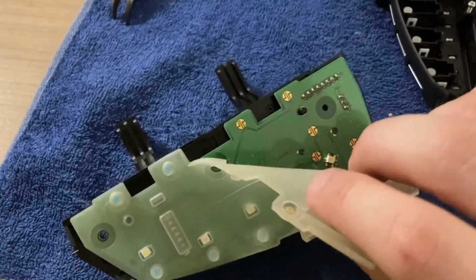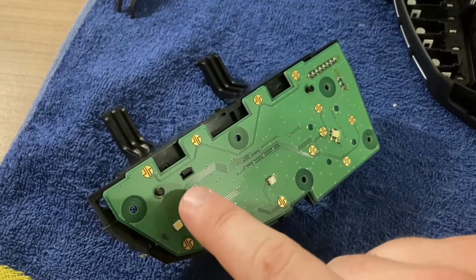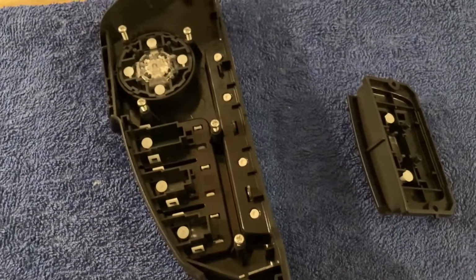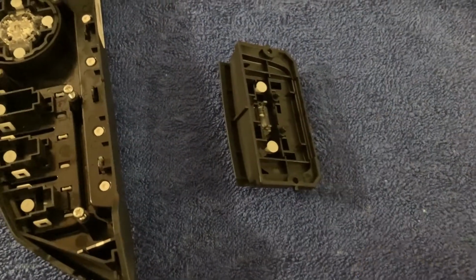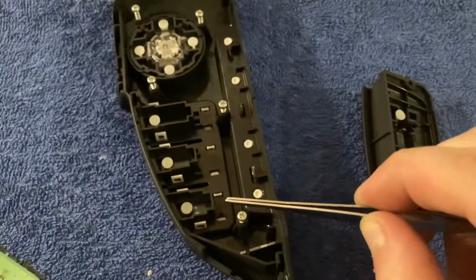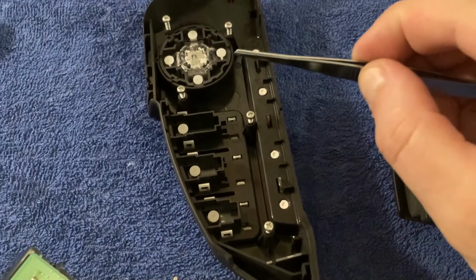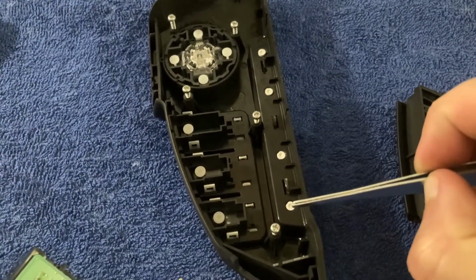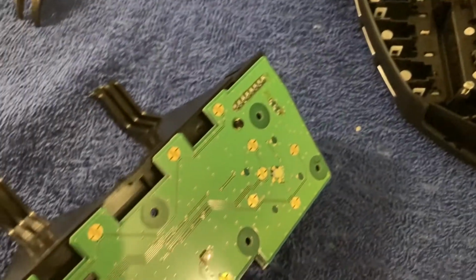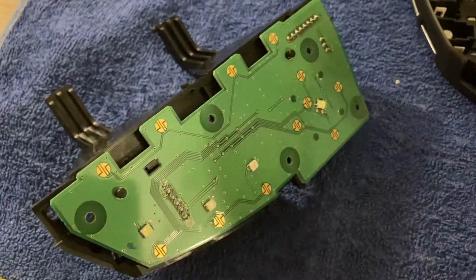And the same in this case. It's held together, from what I can see, in 1 point, which is this one. And you can bring it out. These are the other components. Be very, very careful with these, because these plastic tips, these transparent bits and so on are not glued to the black plastic. So if you tip them over, all of these white things are just gonna fall, and you don't want that. So I strongly suggest not to tip these parts over. Having said that, there's just one more thing left to do, i.e. to disconnect the PCB from this bit.